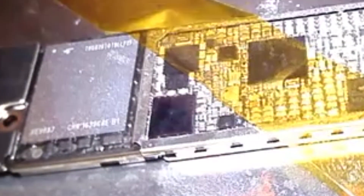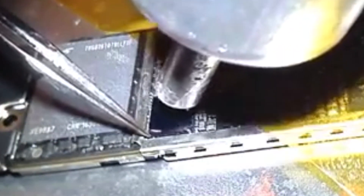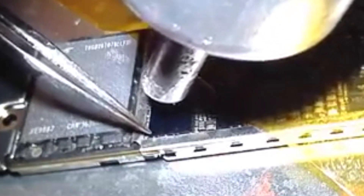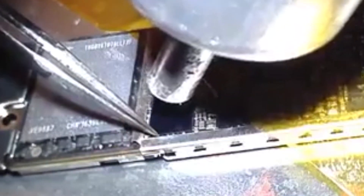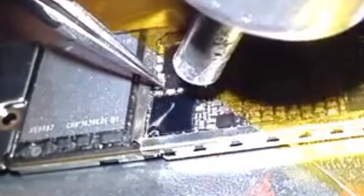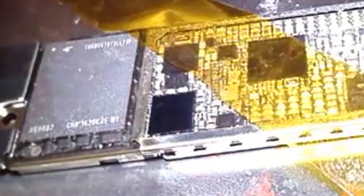So we're going to come in here and heat that chip up. On either side of the chip, I'm going to poke it with the tweezers just to make sure that it's going to seat properly. And again, if you get to the point where that flux is boiling away, you need to come back and add some more — just make sure this thing is liberally coated throughout this procedure. Now that we've replaced that flux that's boiled away, we're going to come back in for a second round and reheat this chip again just to get the board up to temp. There's a lot of ground pads under this, and basically you have to have those ground pads hot enough for the rest of the chip to stick. Chips that aren't grounded are going to seat way quicker than this one, but this one seems to be very critical for this phone to work properly. So we're just going to come in here with the heat and wait until it seats itself — you'll see it jiggle and then lay flat.